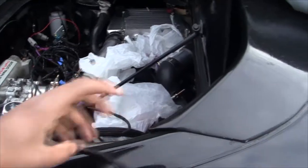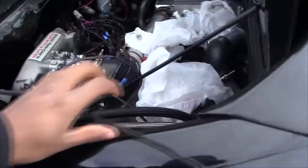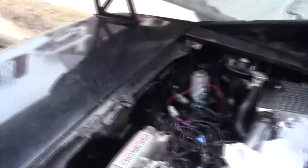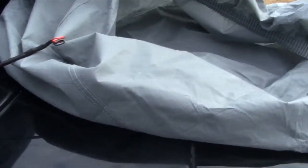I'm wiring up the CAN Lambda now. I went ahead and made a little harness. The little CAN communication port connector they had on there was not great, so I cut it off. You actually only need two wires for this — the CAN LOW and CAN HIGH — which I ran to the source connector they include. I'm going to run all this back to the trunk where the ECU is, and then I need to make another little harness for a relay for power and ground going to a switched power source up front.